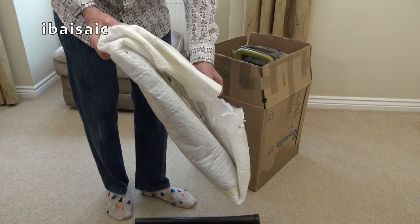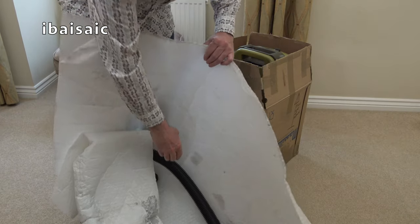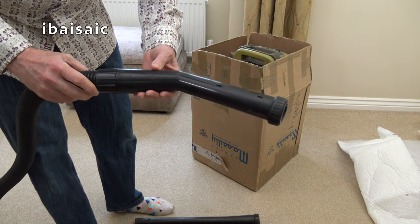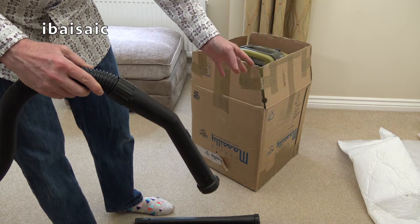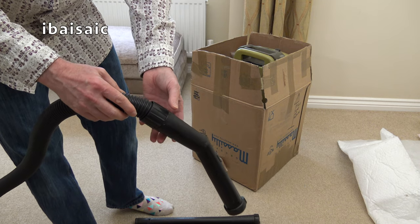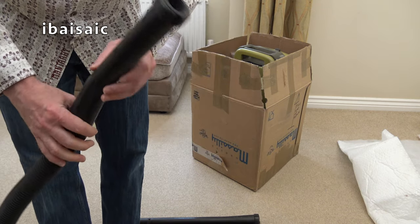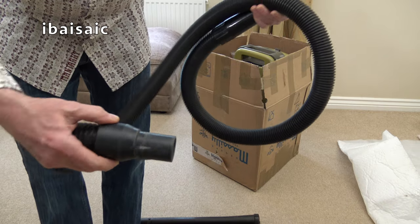It's the hose, of course. Looking at the pictures of this, that's going to need a good soak. It's not a genuine hose — I thought from the pictures that it wasn't. Because this machine would have had a double-stretch hose; I don't think it was ever offered with a flexible hose like this. It was from System 20, the second generation — they did away with the double-stretch hose. I knew this wasn't original, and not only is it not an original part, it's not genuine either.